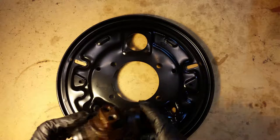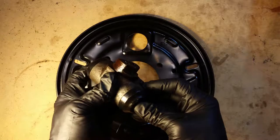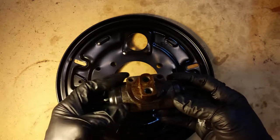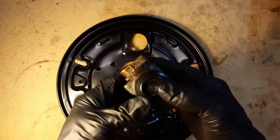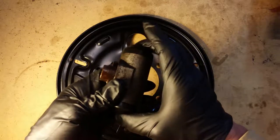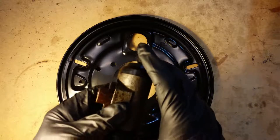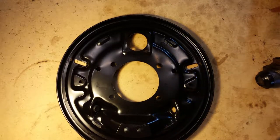Hence not overheating the drum. But if your wheel cylinder is faulty, defective, or just not moving nice and smoothly, just replace it. These are not very expensive — less than $20 usually. You'll have to bleed your brakes afterward, but that's not that big a deal. I replaced my wheel cylinder and it made a huge improvement. Comparing them side by side, the new one was silky smooth going in and out; this one was a little notchy. It's not even that old, so it must have been defective. Just try replacing your wheel cylinder — that's one thing you can do to help your drum brakes work better.